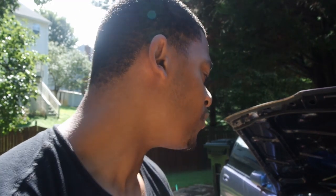Alright, so pretty much I got the new gas in, oil's in it, coolant's in it. I mean, it's pretty much ready to go. I was having one issue. The one issue I was having was it kept blowing a fuse. So like I would hear it prime, and then when I would go to try to prime it again, it wouldn't prime, and then I traced it to basically a fuse that kept blowing. And I think, long story short, the relay, since I am running a Walbro 450, it needs an external relay. And the relay that I'm using that's in the trunk does look a little kind of like melted a little bit. So I think the relay itself is bad and was making it pop the fuse.